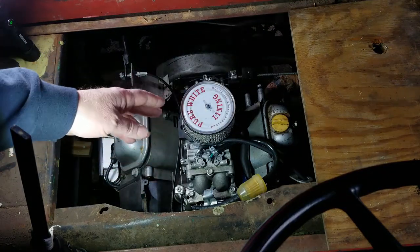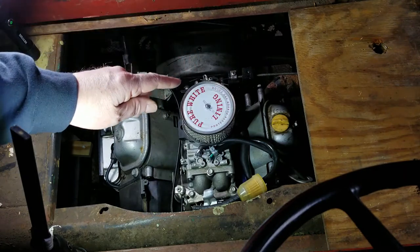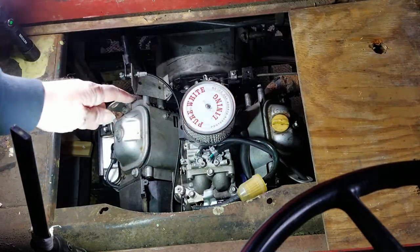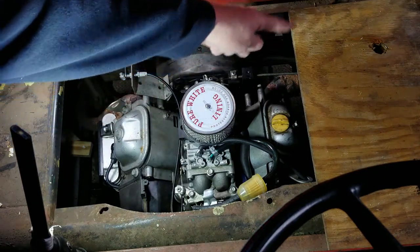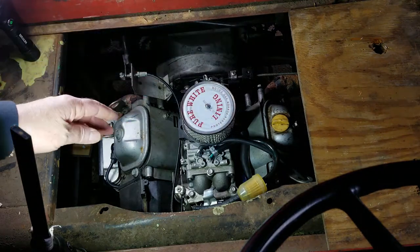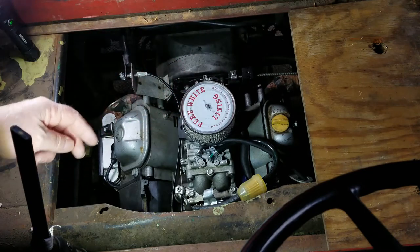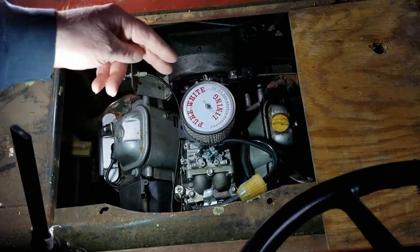So what do you do? You take off the exhaust, you put straight pipes on it, immediately you have a problem — 108 jet and a 105 jet — because the original exhaust had a long side to evacuate and a short side. When they were testing it, they must have had a lean burn on it when the jets were equal. So there's a video I've got out there: Predator jets, fixing the jets, make them equal.